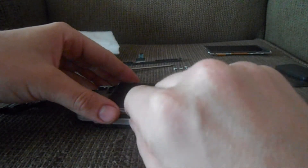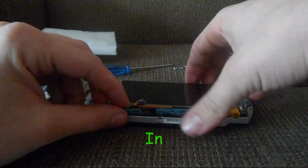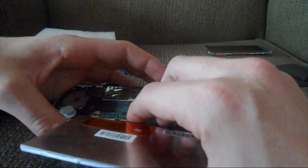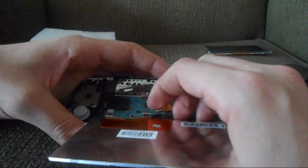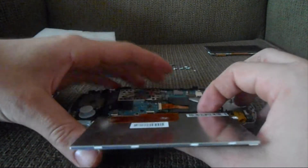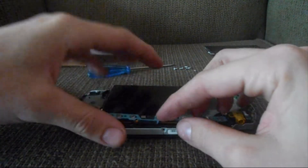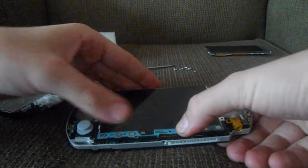If you have a 3000 model you want to be careful with the microphone. Slide the buttons under there and connect the button ribbon back to the motherboard. Make sure they're connected and have the clip flipped down, otherwise the button connectors will just come right out. Put the screen down, the mic on top, and then the button strip — it should clip right in and basically hold the screen in as well.